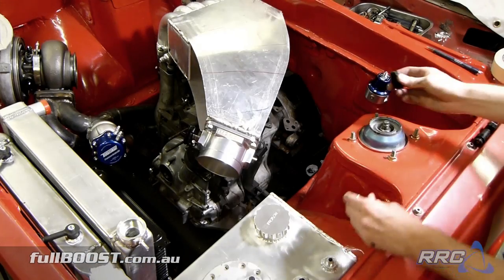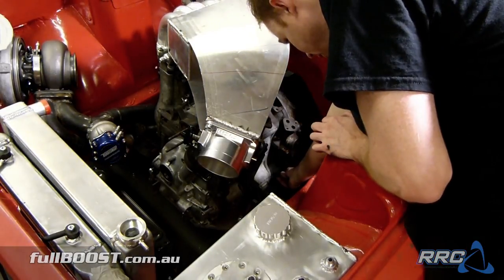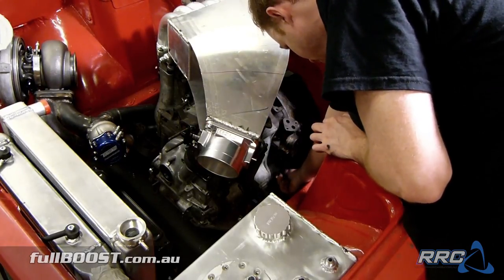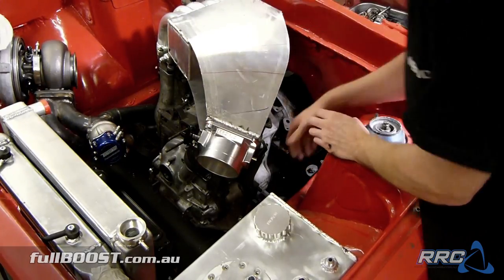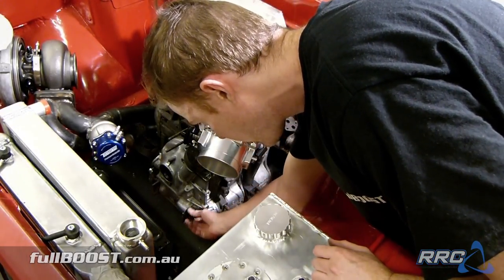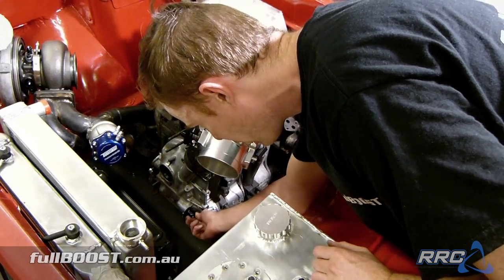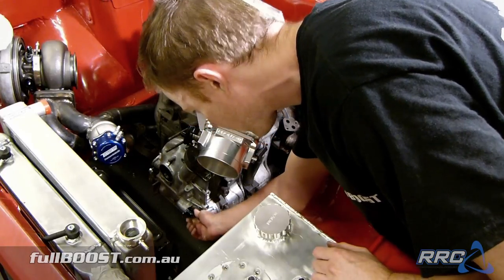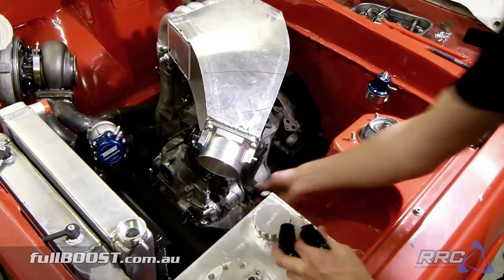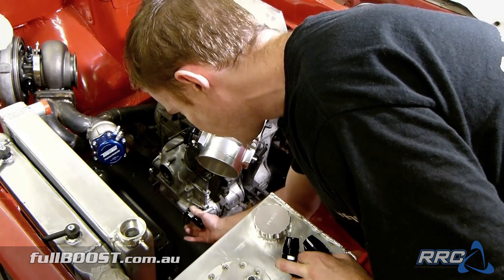All right, so obviously the hose and the fittings exercise that you're undertaking here is one of the more expensive things, I guess, in the build. I mean, all parts of build when you're building racing cars and performance stuff isn't generally cheap. But if you make a mistake here and you have to buy more hose for no reason other than you measured something incorrectly, like the old saying goes, measure twice and cut once. Just start by assembling all the fittings and exactly where they have to go. So forget using a tape measure in the early part.